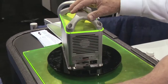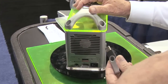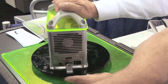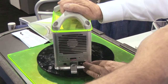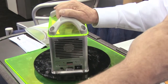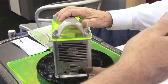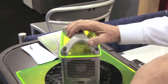One of the unique features of the Ranger is this little key in the back — this is an encryption key. It's not a memory device; it looks like a USB key, but it's actually just a chip that mates with the chip inside the array. When you power the unit on, that enables the encryption. At that point you'd want to remove the key and put it in a safe place. If you don't want to use encryption, just never plug the key in and you can use it like a straight drive. But the encryption keeps your assets safe.